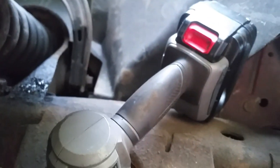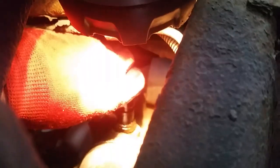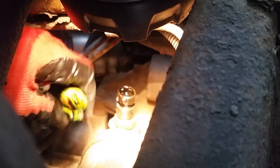Through the magic of putting a light upside down and sticking it above the sway bar, I'm going to try to get my hand up in here and unhook this while holding the camera. Maybe I'll get it, maybe I won't. Look at the oil — that thing is just soaked with oil. Now some of these sensors are two-prong and some are three-prong. This one is a two-prong and look at that, the oil is just pouring out of there, so it's in pretty bad shape. I'm glad I'm doing this now.